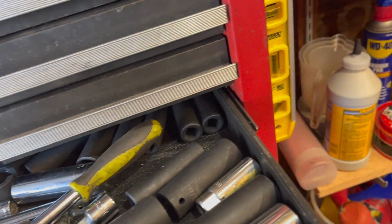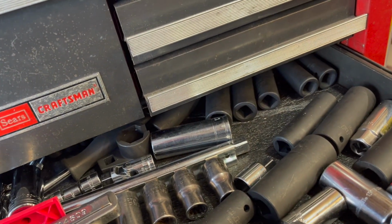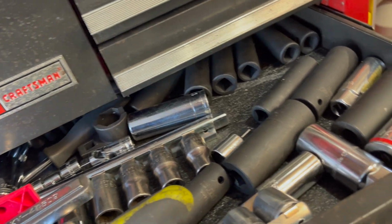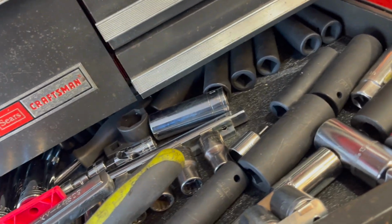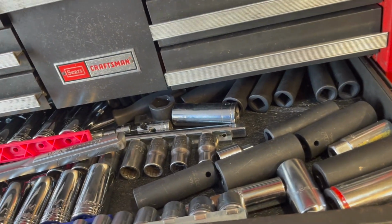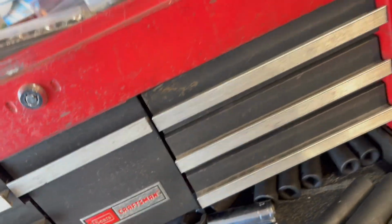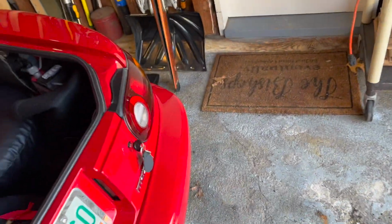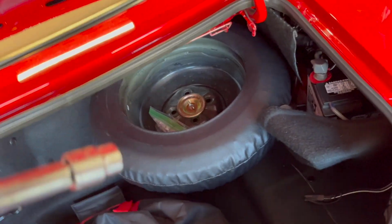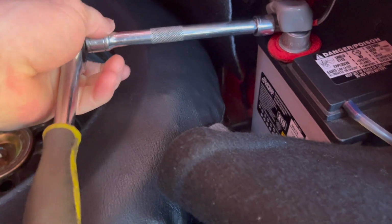Parasitic drain throughout the winter months will cause the trickle charger to work even harder. And some trickle chargers, like mine, just won't charge the battery. It goes into fail-safe mode and shuts off. So that's just how she works. So we don't have it connected during the storage. And of course, you don't want to short this against the chassis, so be careful.